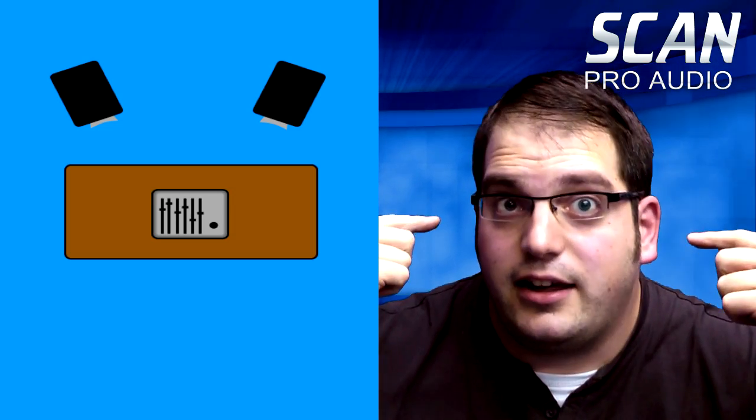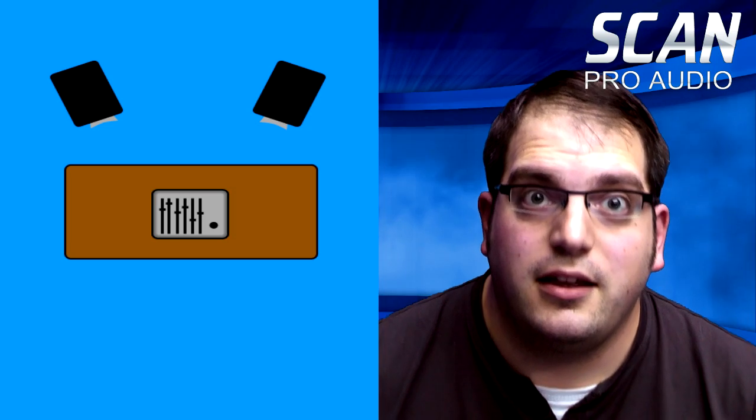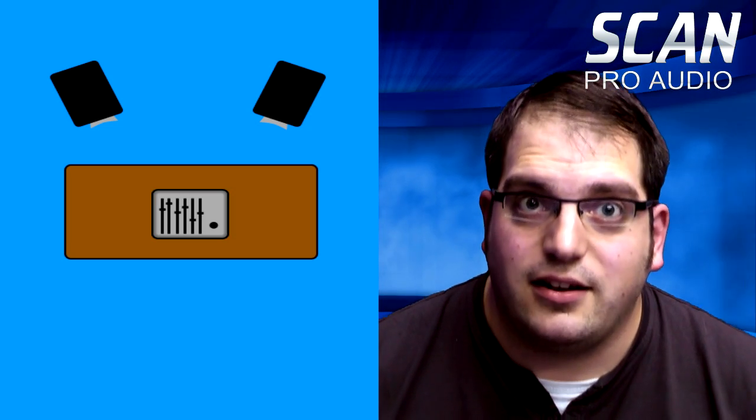The speakers should be put on speaker stands — alternatively, a pile of breeze blocks will actually suffice perfectly as they won't resonate and they isolate the speakers from the floor, they just don't look that pretty. The speakers should be positioned so the tweeters are at ear height when you're sat down. If you can't place them at head height then angle the speakers so the tweeters are pointing towards your ears.